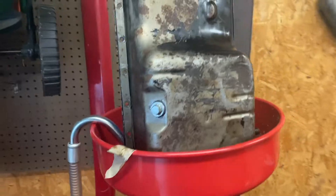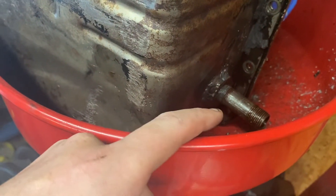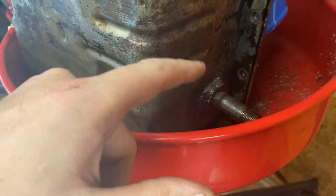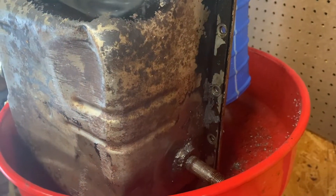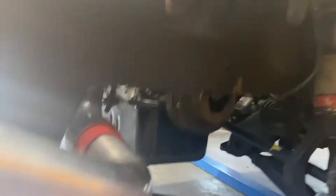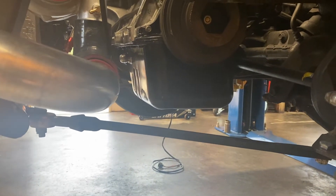The previous return line system was just a slip-over piece of hose with a clamp on it, so I wanted to fix that. Down here we had a 5/8 threaded brass piece, but it was in the wrong spot — we needed it more over here. In order to do that we needed a brand new oil pan, so I got into my parts box, broke out another steel D16 pan, and we put a 10AN fitting in it, which allows us to get pretty close on our oil return.